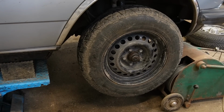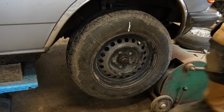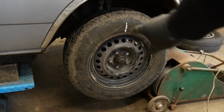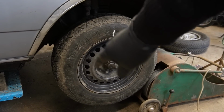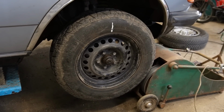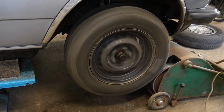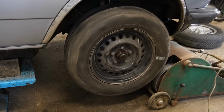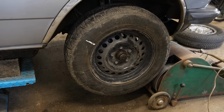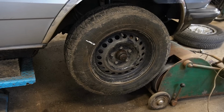So firstly, what I need to do is to just mark a random place on the tire with a piece of chalk. And then I'm going to spin the tire up, and with the flashing, it will show me where the line is on the revolution, and then I will mark that. So let's try that. Oh, an important thing is I need to find the moment with the lowest revs and the highest reading on the gauge, and then mark the position.